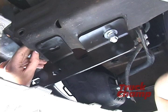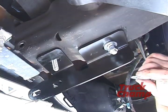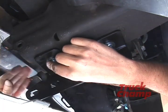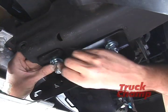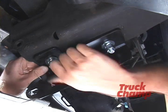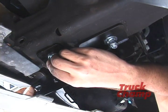We're going to stick the bolt up through the frame of the vehicle into the front hole. Notice there's a washer already in there. Then take a regular M12 flat washer, an M12 locking washer, hold the bolt in place, and put an M12 nut on the end — hand tighten this. So we have the passenger side bracket mounted to the frame with hand-tightened nuts, and we'll come back later to fully tighten those.